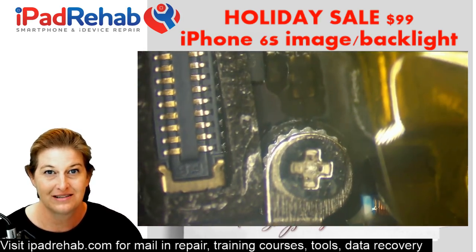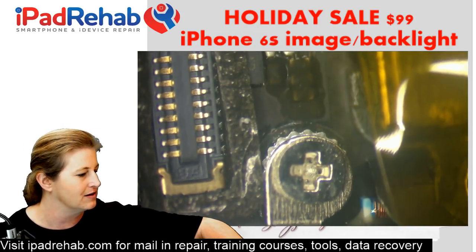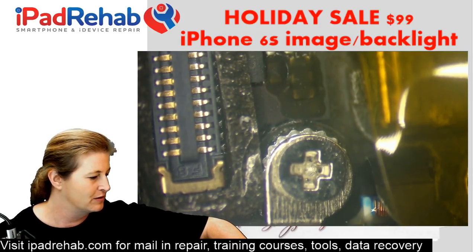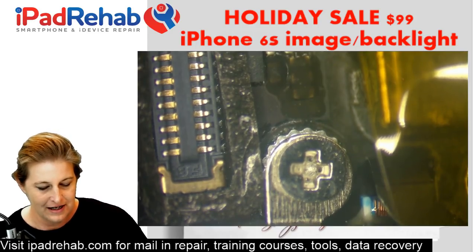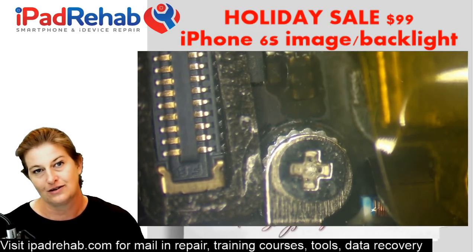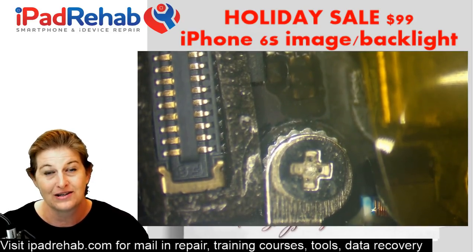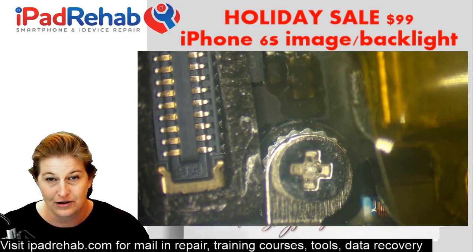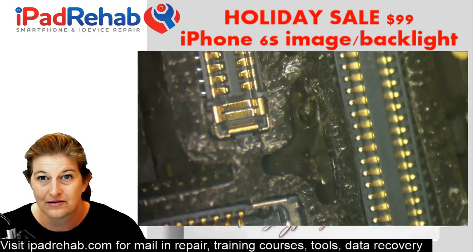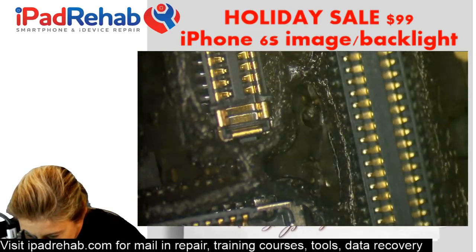The reason you can't jump the filter on a 6s is that the likelihood this phone will have another cracked screen someday is high, and the likelihood that repair goes to someone who still thinks you can change screens without disconnecting the battery is also high. If you put a wire there, the filter can't blow to protect the circuit. The next time someone changes the screen without disconnecting the battery, there's no fuse — you'll get a short to ground go all the way back, blow up your diode, and cause a big train wreck under the shield in an area of really tight clearance. That screws the customer, potentially causing them to lose their whole phone.